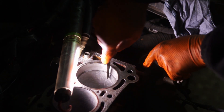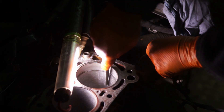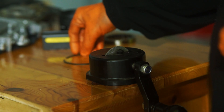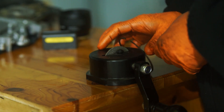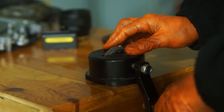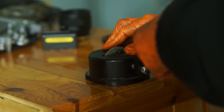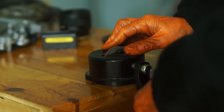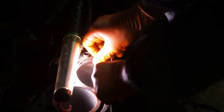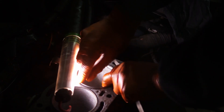So I am going to take off about 0.1mm with my piston ring file to get them to the measurements I'm desiring — 0.5 and 0.4mm. The tolerance on the 4AGE pistons is 0.3 to 0.7mm and 0.4 to 0.8mm, so I am still very much within spec and I'm not going to have excess blow-by or any loss in compression despite the larger gap.